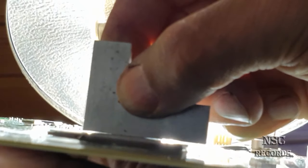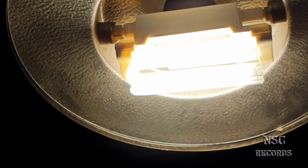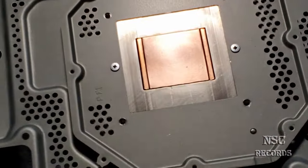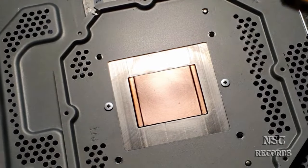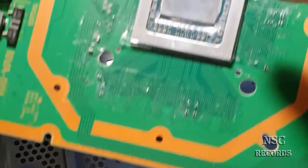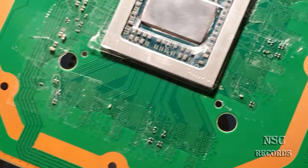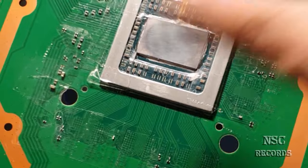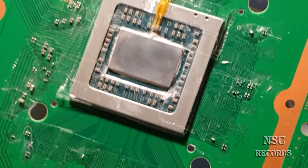I have done the rest on my copper cooler because I just don't want to lap too much on the APU - it can be dangerous. If you lap too much on the APU, you're going to destroy it - the APU, CPU, or whatever. That's why I also don't want to apply liquid metal thermal paste, because maybe I'm already very deep and I just want to protect my chip. I think I'm going to go with Cooler Master. I also want to stop opening and closing the PlayStation constantly - it's just not good for the screws.